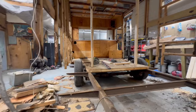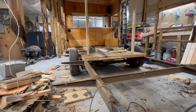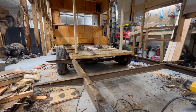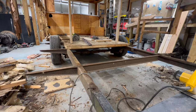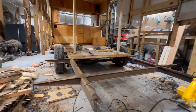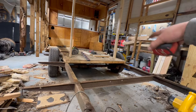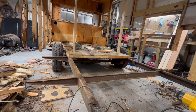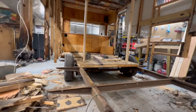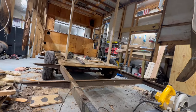So then what I can do is, if I get to it tomorrow, then I can finish, once I've got that new wheel opening, then I can resupport, run new lower plywood, new joists, if you will, and then my new top plywood all out. Once we've got that consistent floor plan everywhere, then it's pretty straightforward. Then I can resupport all my walls coming down. I'll be doing some sistering and some blocking and whatever. We're going to make them nice and strong. We'll get that squared away. Then once we know that the structure of the camper is back, then we can reshape our back wall here. And we're in good shape.